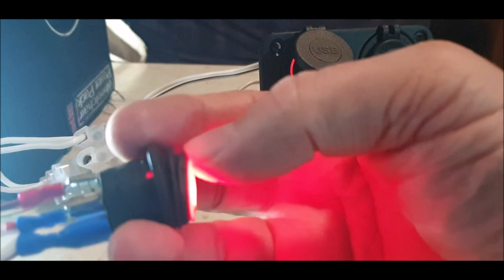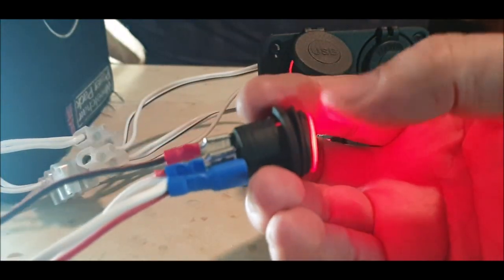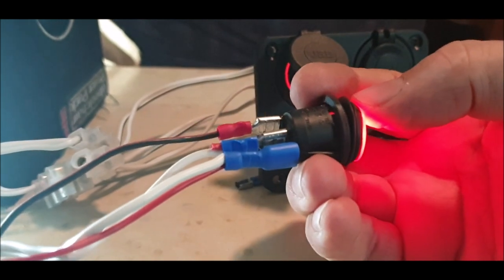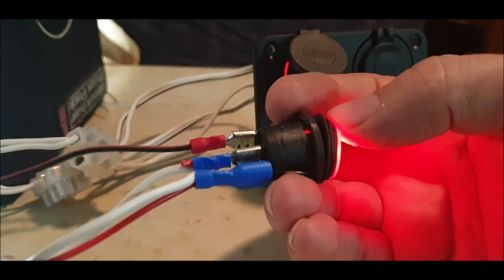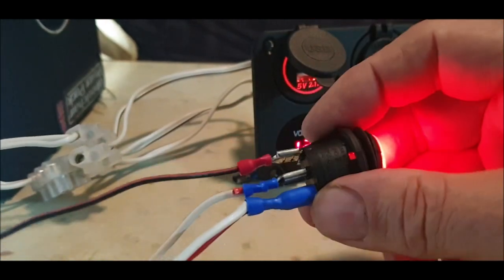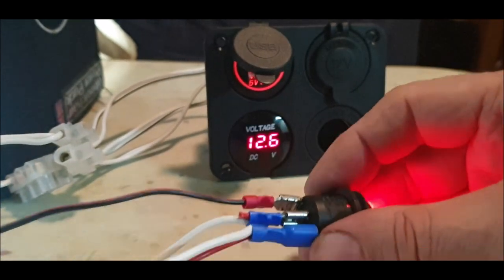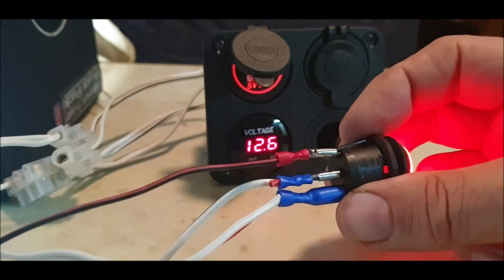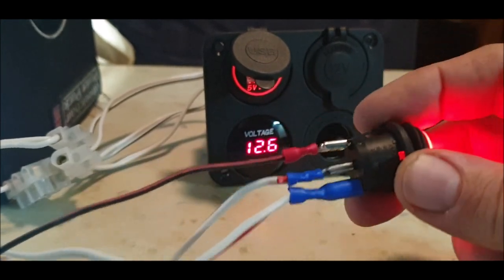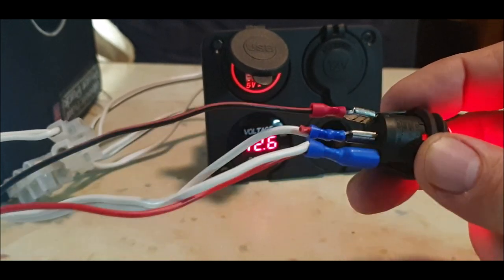And that's it. So there's your switch. So you've got a live, which is also for the bulb. And then you've got your switch for your doobries. And it is quite straightforward once you suss it out, but I'm just being a thicko today. I've done a few of these, but they come with no instructions. There's no positive or negative on the switch. The switch is just fitted inside a cigarette lighter, so it's a bit of a poor jobby. But I thought I'd try and shed some light on it. So I hope this helps somebody. Sorry it's been a little bit confusing, but I'm confused as well a bit.